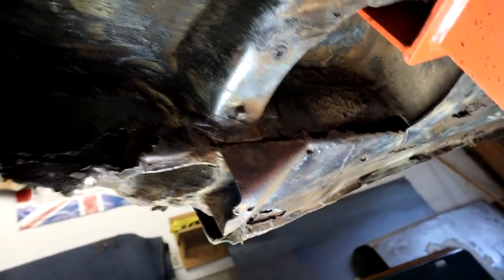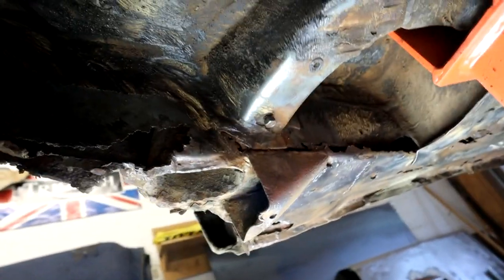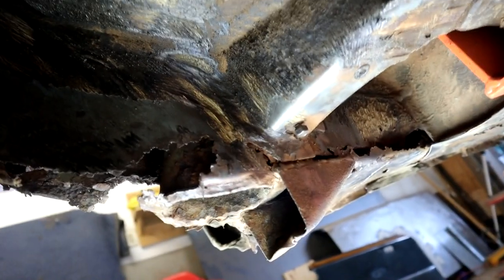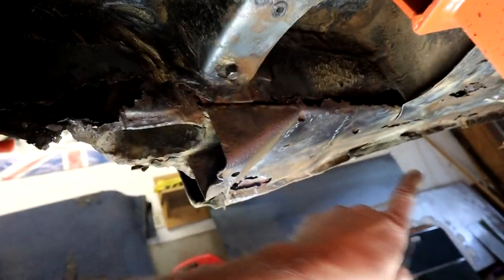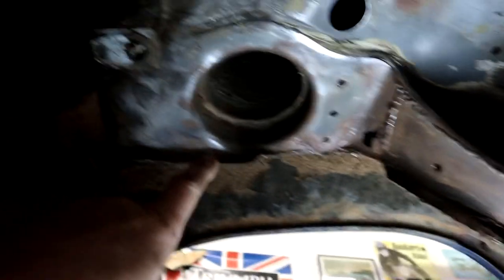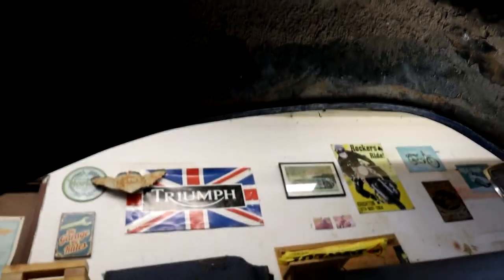My approach is to dig in far back and build my way out. No good trying to do repairs on the outside when it's worse deeper in. Luckily I've got the other cars for templates and measurements. This is a major part of the damage on the car. The other side is in really good shape. Further back to the floor pan, that's a typical replacement panel which isn't too bad, and the inner wheel arch lip doesn't seem to be in bad shape on this side.